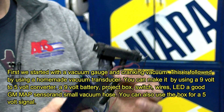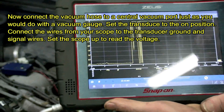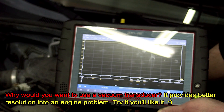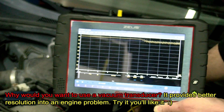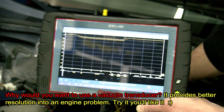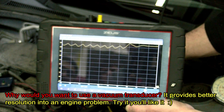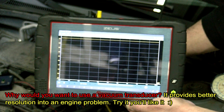Five volts. So now let's crank this over. There's your cranking back in the pulses. We can make that bigger — let's drop the voltage. There you go, there's some good humps. If you look at those humps, you could actually see where we were at.